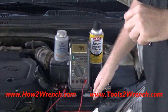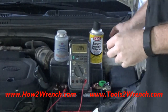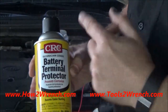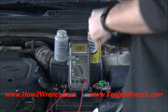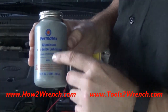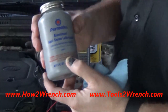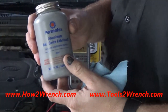I'm going to show you what a good test looks like after I replace the battery with a new one. Before I fire it up, a couple of notes on battery installation: I love this spray — I'll put a link below — you spray it on after connecting the battery to give protection from the elements. For the battery mounting bolt, I like to use anti-seize. Don't be thrown off by it saying aluminum — it works great on steel applications too, like a steel fastener into an aluminum part, so the bolt won't be so difficult to remove next time.